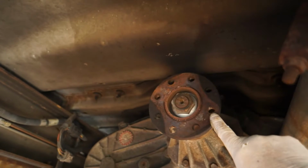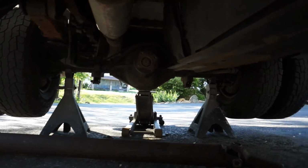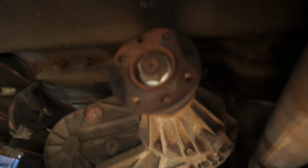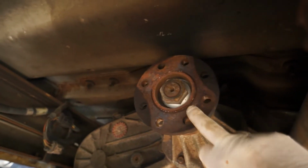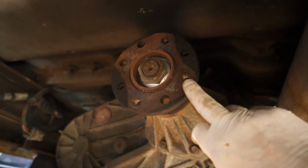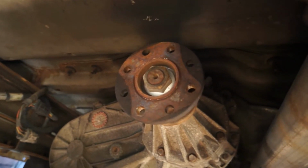Just make sure you use the blue Loctite here on the transfer case, and you also use it back there on the rear diff on those 4 bolts, those 12-point bolts. If not, it could loosen up on you. They come factory like that. So make sure you use the blue, not the red. The red will not come off later without excessive heat. The blue will zip right out with the air gun. So let me get raw and finish up.